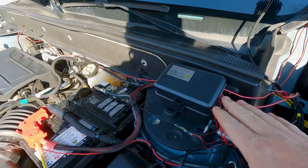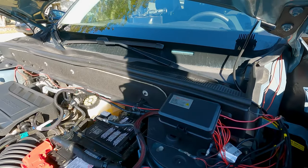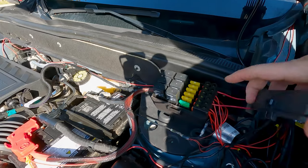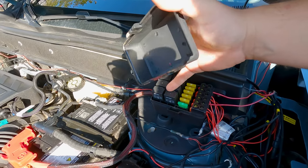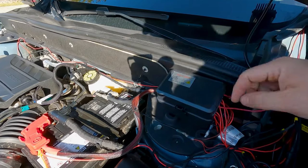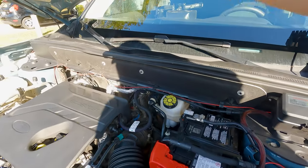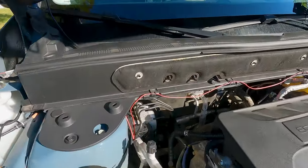Excuse the mess — we haven't tied everything up. We did have to take all this apart when we had the windshield changed and I just haven't gotten around to zip tying everything back up. But this panel here is the actual aux beam controller. It has six channels, six relays, wires coming in. We did upgrade the fuses inside here because we're running a little bit more power through the system. We did take the underglow off and the rocker lights off. Basically we have the controller wire here, and this wire ties over for the pod light.